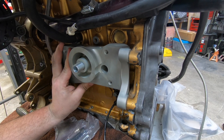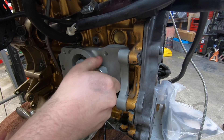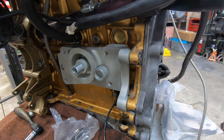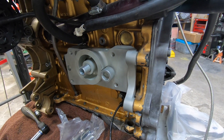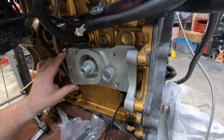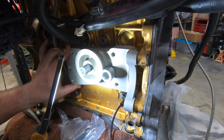Here we go — lining it up, and look how that lines up with the block. It bolts up to the backside and then goes right here in the center. We'll get this big bad boy started so it kind of holds everything in place. And there's your base plate — this is how your plate is going to be installed, this is how it's going to look. I'll even grab the GoPro real quick so you guys can see it. And if this is anything like my 24 valve bracket setup, the tolerances are very tight for specific reasons. Keep in mind as you're installing these — be careful, use a light, don't screw anything too tight because you'll probably strip it.